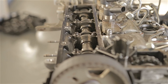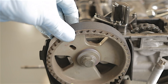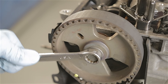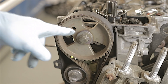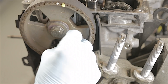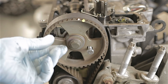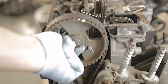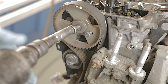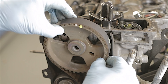The camshaft is all in one piece, but what I found when I took the cam belt cover off is that the camshaft sprocket is actually loose. If I put a spanner on the bolt the camshaft is turning but the pulley isn't. I'm going to turn the crankshaft round so I can get it to the hole to lock it and undo this bolt. The sprocket's in the right position but I can't hold the camshaft, so I'm going to have to use an air gun to undo this bolt. That bolt was in bloody tight - and it shouldn't be tight like that.